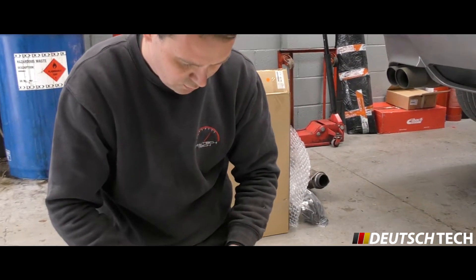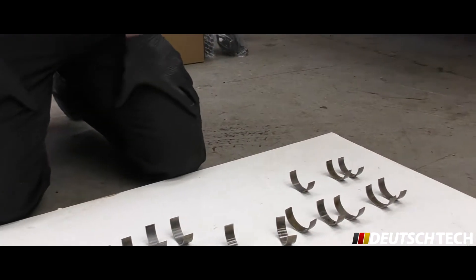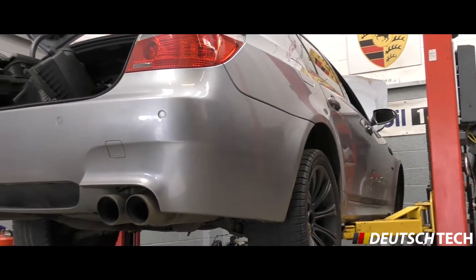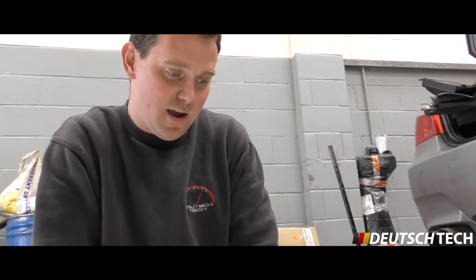This is a really good preventative measure — changing the shells once the engine starts to get high mileage. We do a lot on the S65. The S85 on the E60 M5 has exactly the same symptoms, and it's a good measure to get them changed. In terms of costs, you're looking around the £1,200 mark for the E90, slightly more for the M5 because it has two more cylinders. But it's a lot cheaper than a new engine, which would be in the region of seven or eight thousand pounds.